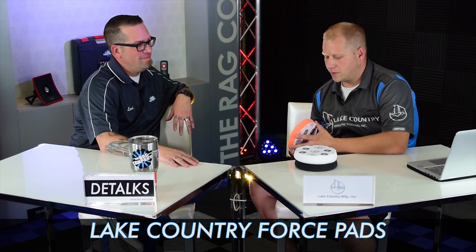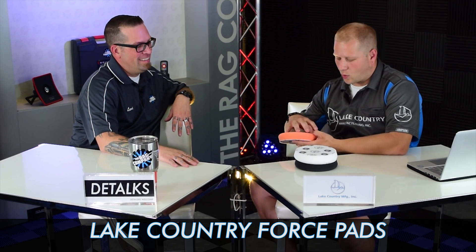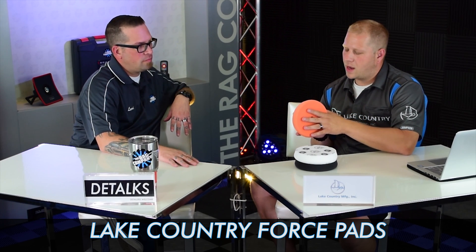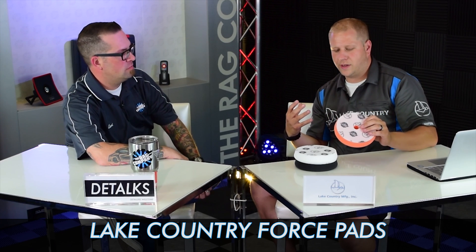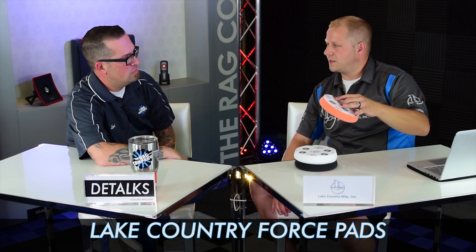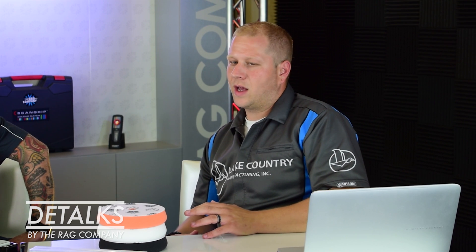What's nice about this foam is it's relatively firm with a nice coarse cell structure — it cuts very well. But just like we were talking about with HDO pads in a previous video, this pad works the opposite way. Instead of staying firm, as you cut and it gets warmer, the pad softens to give you your maximized finish. So even though you get a good cut, you get a good finish too. The reason it's like that versus a long throw polisher is once the pad softens on a long throw it starts to move around and you feel that in the machine. But because it's a gear-driven machine with a smaller throw, this outperforms a pad like that — really maximizing and engineering a pad for a certain machine to give you the best results.